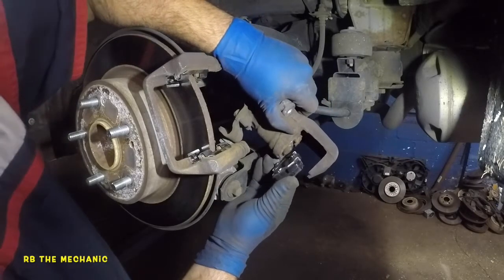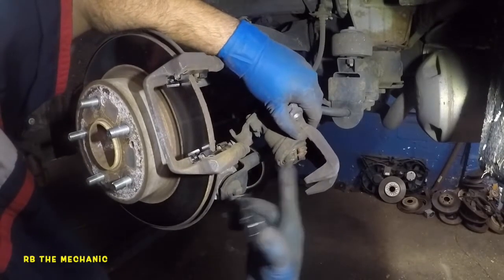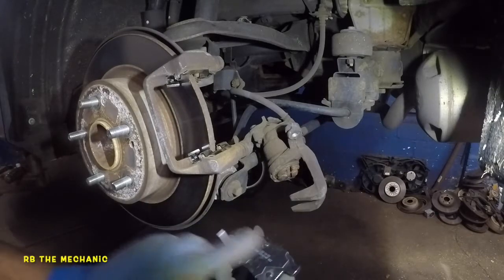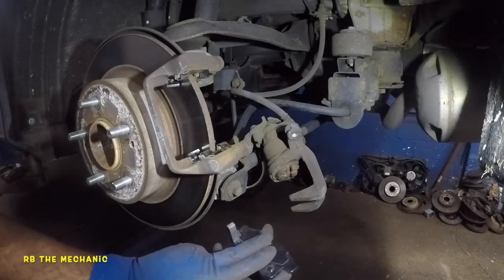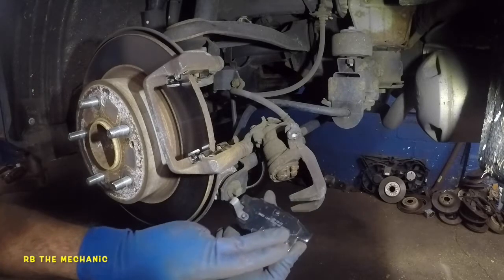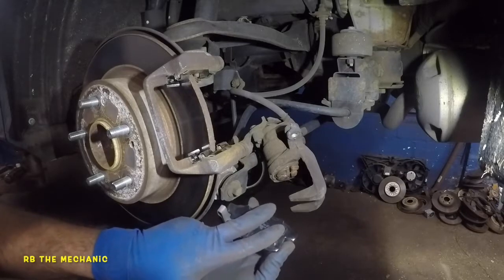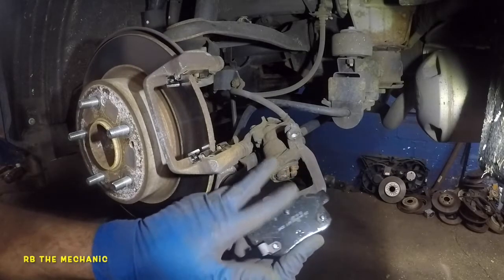This little notch on the new brake pad sits into that little cross right there — it simply sits there, and that stops the caliper piston from turning. That's another function of the cross. If you don't get it aligned there, your caliper will sit crooked, your brake pad will wear out unevenly. It will try to turn back and eventually fall into the hole, but if you have bad luck it might just sit there, your e-brake might not work, and the surface won't be flat and flush.